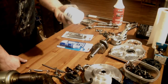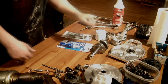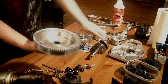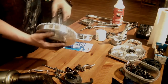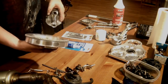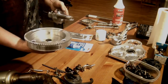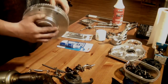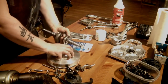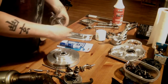You need valve grinding compound. The reason you need it is when you get a brand new flywheel, you actually have to what's called lap it to your crankshaft. What that does is the freshly machined surface inside of the flywheel will take the shape of the crankshaft's taper so there are no vibrations and it can't rattle loose. This is a very important step — some people don't do it, but I'm going to do it.